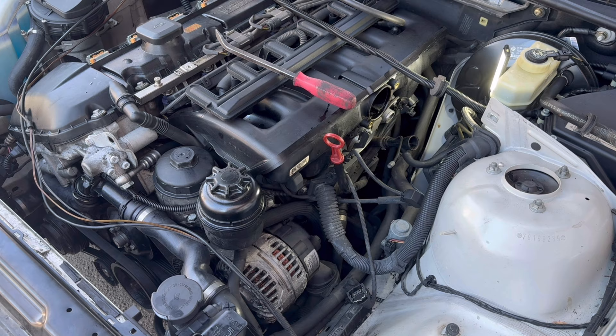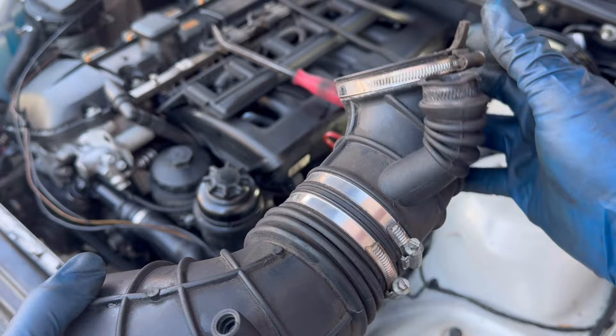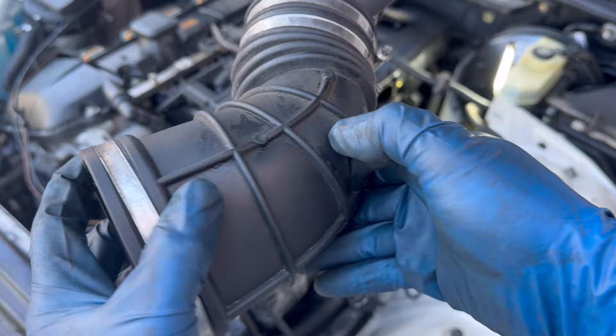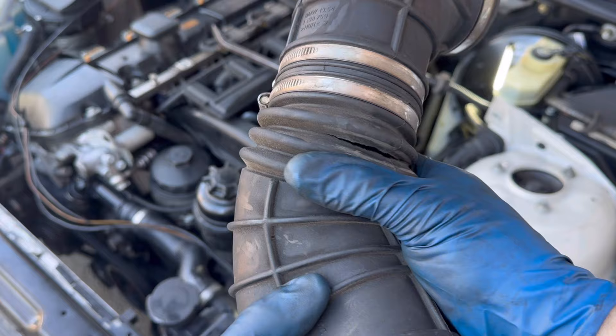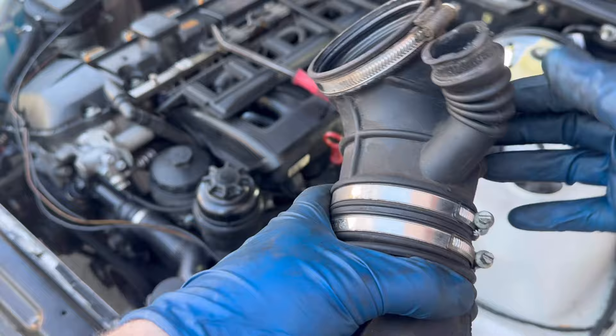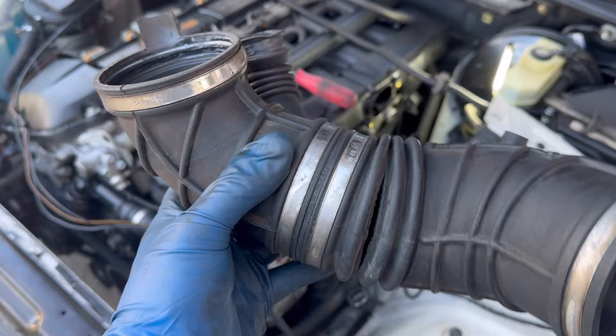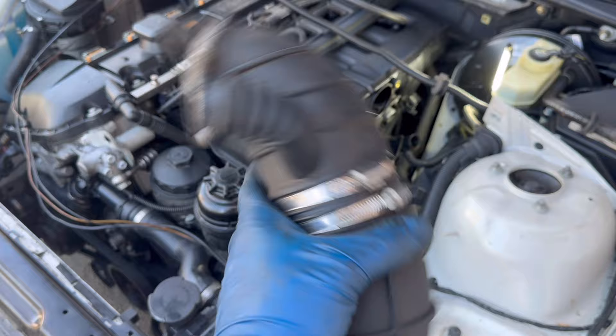If the clamp had already been repositioned so someone could actually reach it, it would have just been a couple of minutes. Check these boots — they being upside down suggests this is original. Look around the F connector for tears. The back side shows a tear — that's definitely an intake leak, causing lean codes past the MAF. Not good. The other area looks fine, but we've got it off and we're going to replace it. This one especially feels really hard, so we'll order a set.